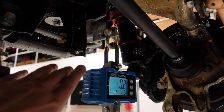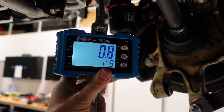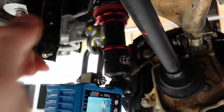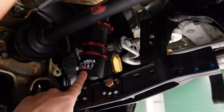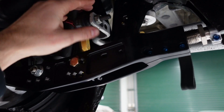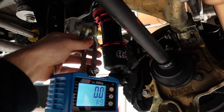Here I'm looking at the other side of the car — this is the left rear corner. I've got some of the suspension components removed to give me access to the anti-roll bar, and this is how I'm going to measure the stiffness. I've got a weight gauge hooked up to a large ratchet strap that's on an anchor. I'm going to pull down on this end of the anti-roll bar and measure how far it moves and how much force is required, in a few different increments. Because the suspension on the other side of the car is on the damper controlling the droop travel, this side cannot move lower — so when I pull down, this part of the anti-roll bar will essentially be locked. That means the force I apply is only going into deflecting the anti-roll bar and nothing else significant on the car.